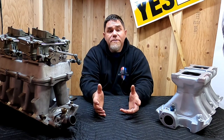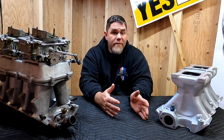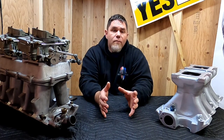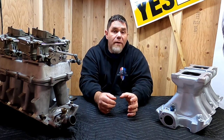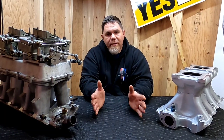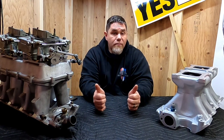For a stock type engine, you need to size the carburetors on the small side — 500 CFM, 450s, 390s for Holleys, and definitely no more than 600 CFM. Low speed drivability does come into play, but you will get the added rush of having multiple carburetors up top. Tunnel ram setups are completely different, which leads us to the next question: progressive linkage or one-to-one — which is right for you?